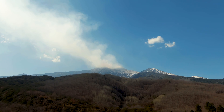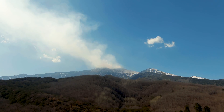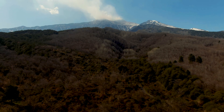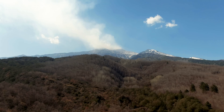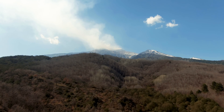In recent weeks the gimbal of my Mavic started to get big jumps from time to time, as you can see, and the problem got worse day by day. Once again I calibrated the IMU and the gimbal as well, and the problem was again solved. You should calibrate the IMU when unboxing your drone, and every time you notice unbalanced flying.